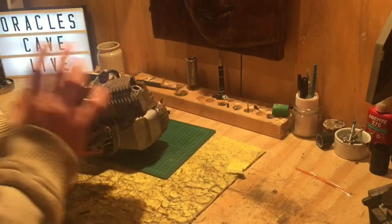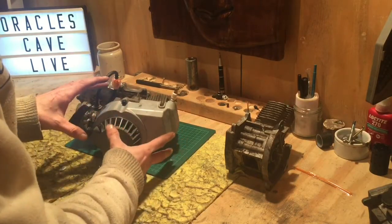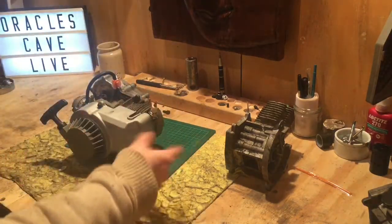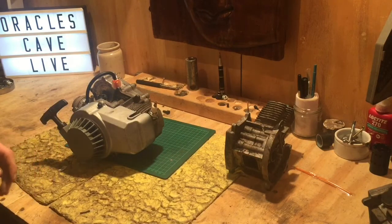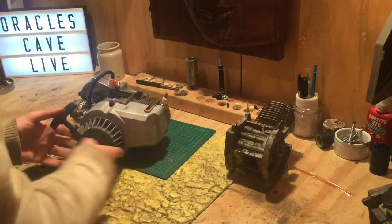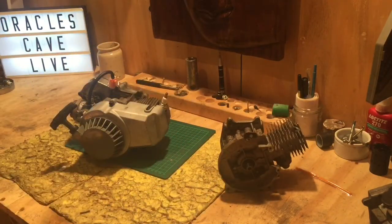On a normal 50cc engine the head might just stick out, so you can just wait for the next part. For these kind of engines and the mini-motos they have a casing over the side so it's in the way and needs to be removed. You'd be advised to take your spark plug out and keep it aside safely, but I've never had a problem keeping a spark plug in and removing the head. So the first part will be to take off your pull cord and get it out of the way so that the head's nice and clear to get at.